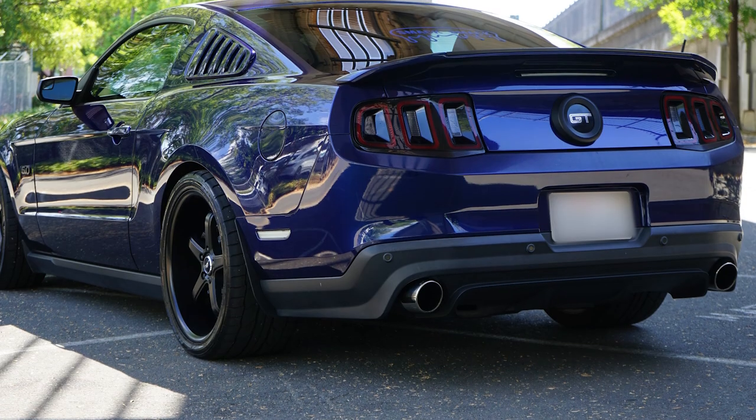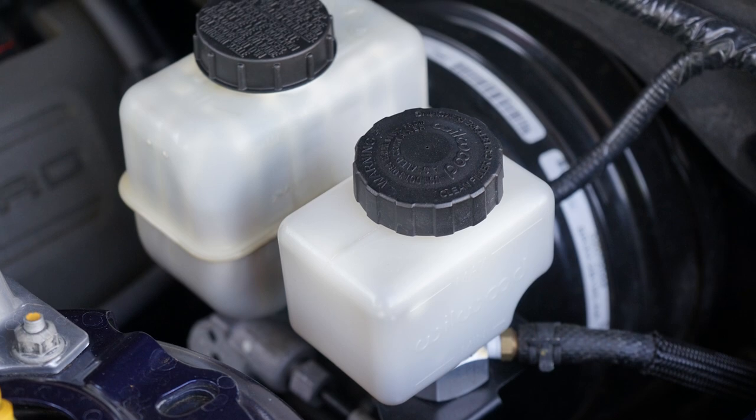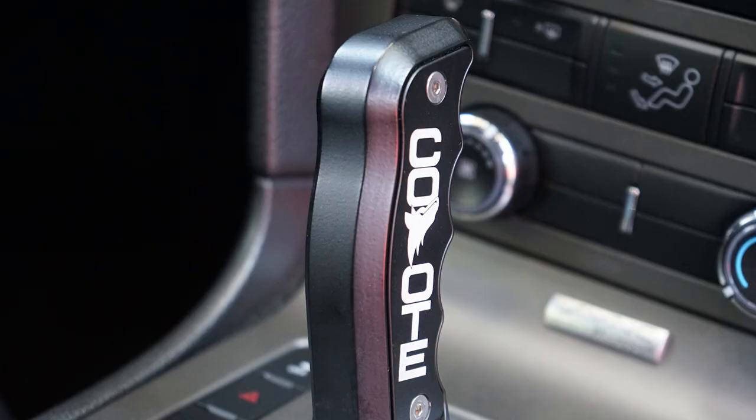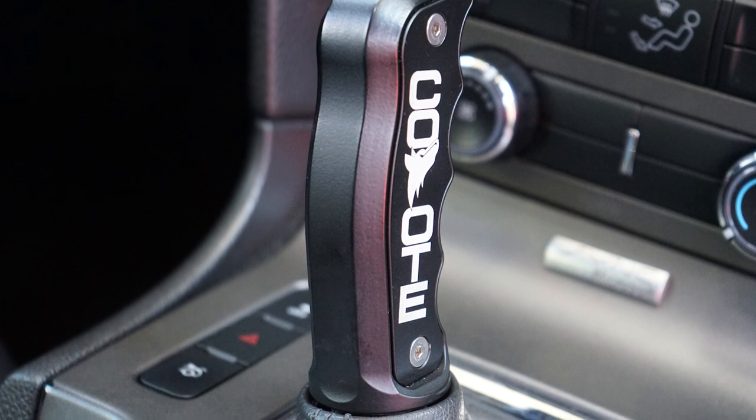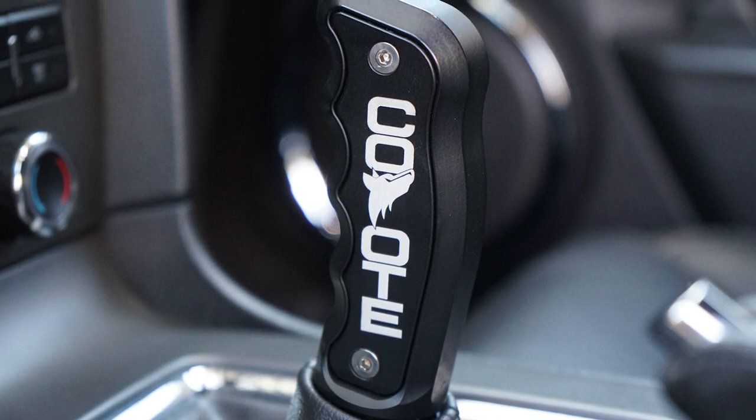Your mods have been very purposeful. That Shelby dual ISO reservoir kit — I put the same thing on my car because I was having clutch issues with the pedal sticking on the floor, and that cured it right up. How about for you? Yeah, I got the reservoir and the Steeda clutch spring. Those two alone made a big difference with that sticking-to-the-floor problem at high RPMs. And I love the handle too — the coyote pistol grip shifter. You don't see the pistol grip a lot. I tried it out and it took maybe a day or two to really get the feel for it, but once I did, I love it. I damn near won't ever go back — you can just grip it so much better.